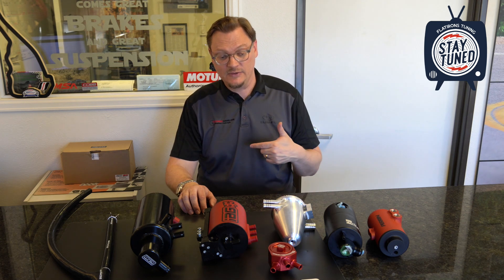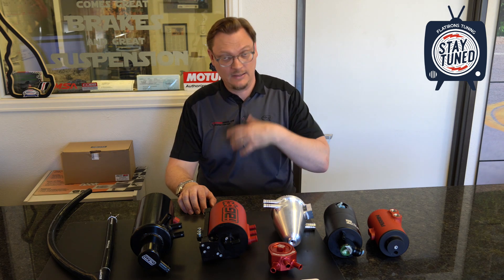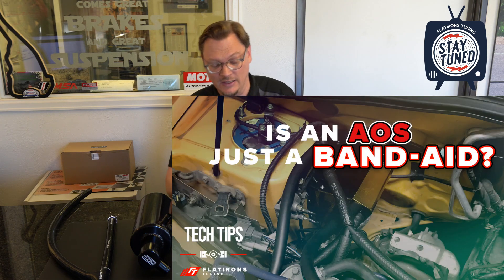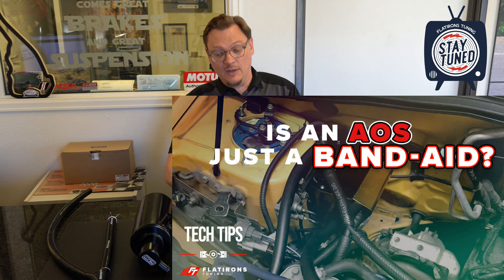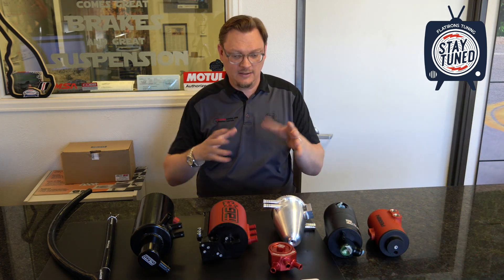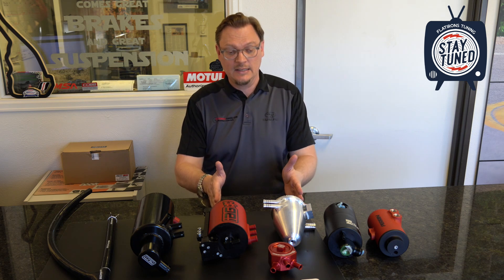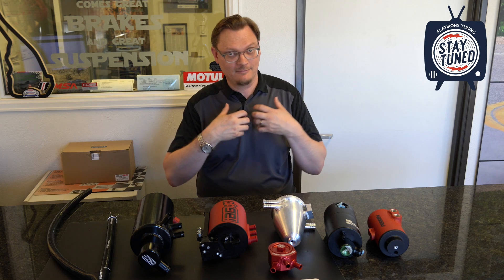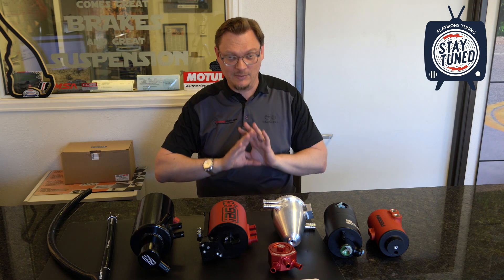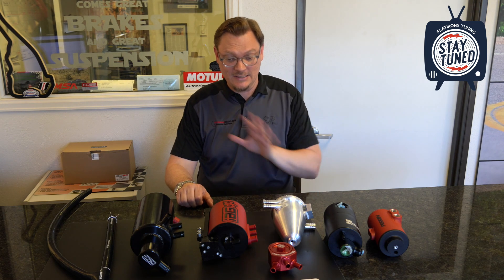The other caveat at the beginning here: the thing you have to keep in mind with an air oil separator is this is a band-aid — this is not a solution. I actually did a whole other video just on that topic. You have to keep that in mind, because it's really easy to put one of these on a car thinking it is a solution to the problem, install it, and just forget about the AOS and think 'well, I installed this, the problem is now fixed, I do not have to monitor or keep an eye on this thing.' But that's not the case.